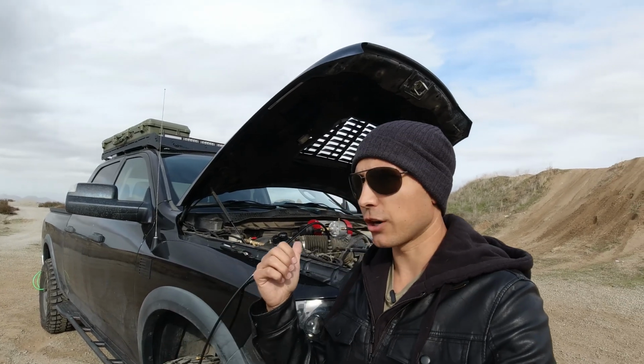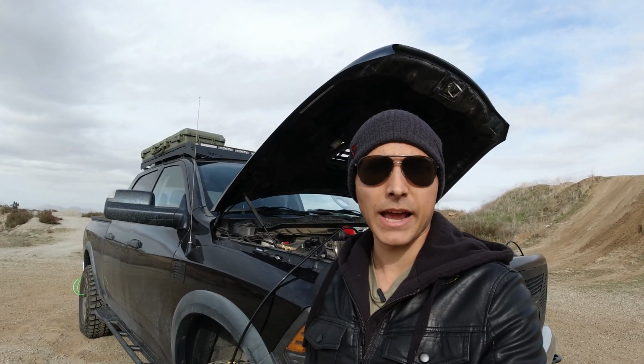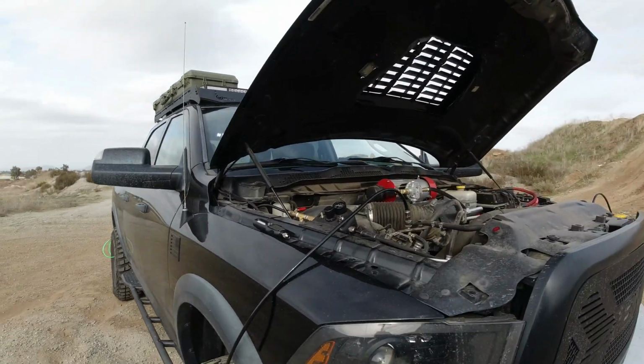Now, I had to split filming into 2 different days to make sure that I could show you both situations that I've run into with the up-down air unit. So the first one is going to be using the regulator on there, which is how the system is designed. So I will be setting it at 35 PSI, and then we'll turn the compressor on and let it run. I've got the truck running and I've got my pressure set at 35 PSI, so let's flip on our compressor.